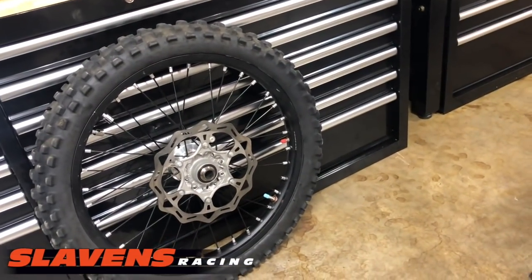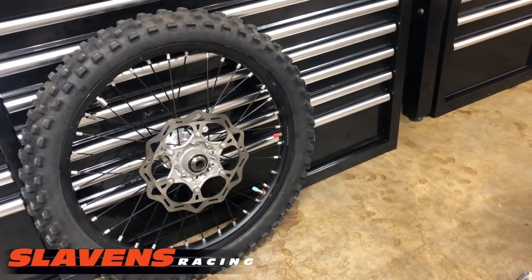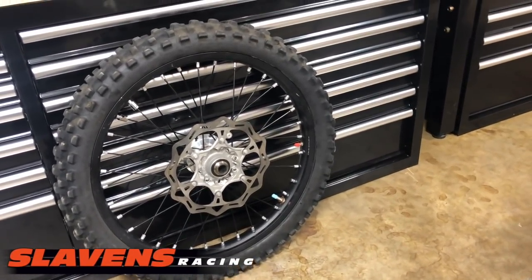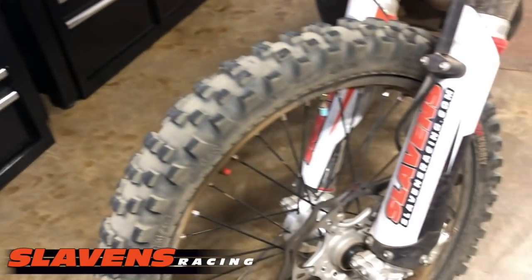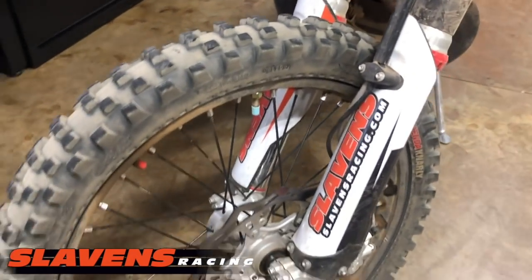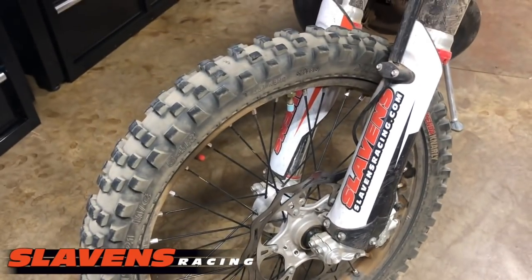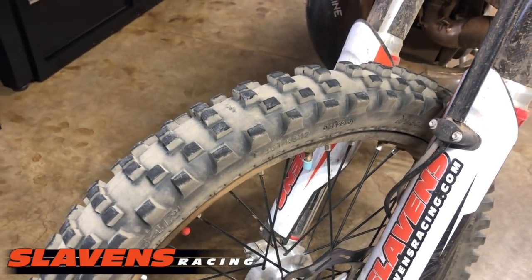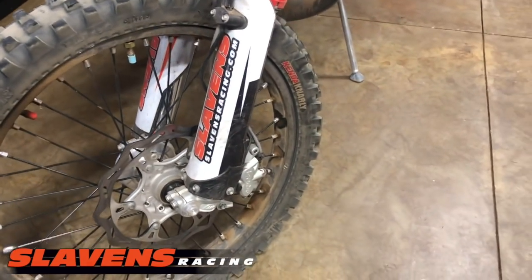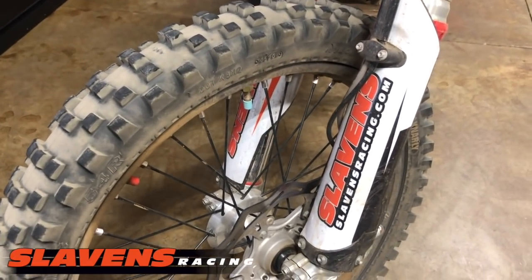M59s at around 150 to 200 miles, the carcass starts to degrade on them. At that point I increase the air pressure because the carcass starts to get soft. I've not felt that on this tire yet, although I have changed the pressures around, which I'll explain in just a second. So when I first mounted this up about a month ago — this one has about 200 miles on it — I put it on the same time as I did the rear JX8. It has not developed that squirmy feel.